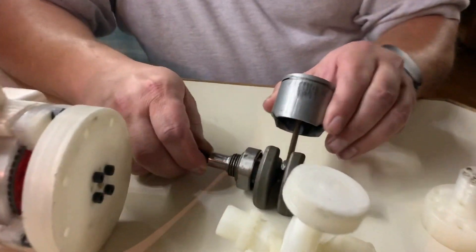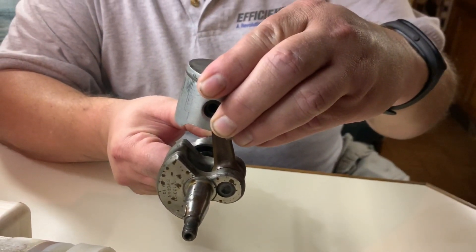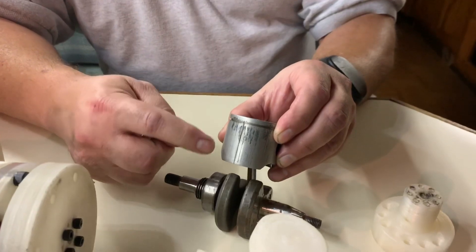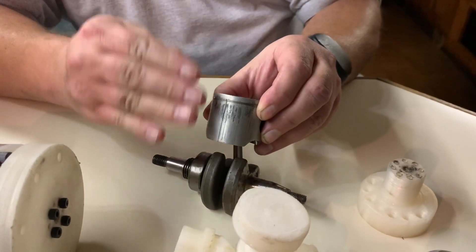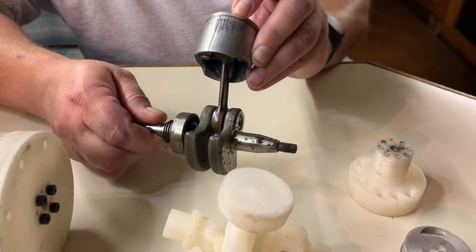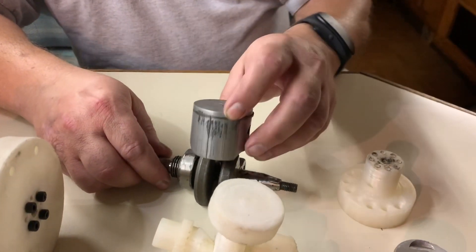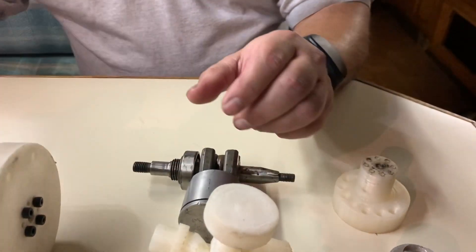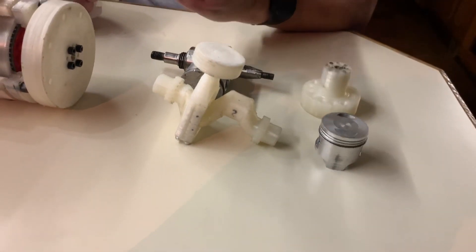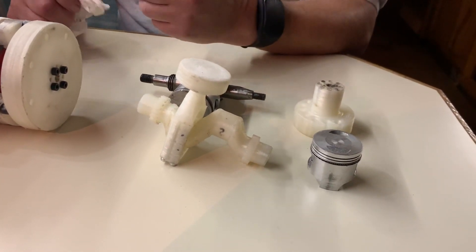Most of you know that in a conventional engine you've got your connecting rod and wrist pin relationship, and during the combustion cycle there are a lot of forces pressing the piston into the cylinder wall, sometimes causing rocking of the piston and wear on the skirt. This design eliminates the wrist pin and that rocking force, reducing friction that can be responsible for at least fifteen percent and probably up to forty percent of the friction present in a conventional engine design.